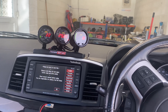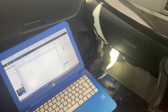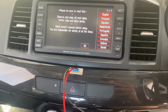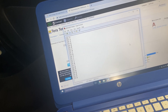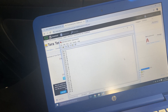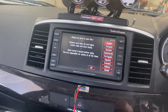It's the next day and I Amazon Prime ordered a serial to USB adapter. Don't be a silly billy — make sure you fully understand the instructions. I thought the pin-out was from the face as we're looking at it, but the pin-out in the instructions was the other way around. So it's only taken me about five hours to diagnose the problem. I've been using HyperTerminal, which is basically software that allows you to talk to different computers. I realized the laptop and the wideband weren't communicating at all — the signal wasn't getting from the port to the USB port.